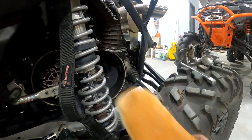I'm going to introduce to you the special tool we're going to use to pull this primary clutch off with no problem — boom, just your classic bread. White bread, wheat bread, hot dog bun, hamburger bun, doesn't really matter. A lot of people will use grease to create hydraulic pressure to pull the primary clutch off. When you try to use the puller dry it doesn't do anything, or they bend a puller. Grease certainly works but it makes quite a big mess that can take a while to clean up, and if you don't clean it up you risk having grease left on the taper, which causes the clutch to spin on the taper and snap your primary bolt — then your primary clutch falls off. With bread you don't get that.